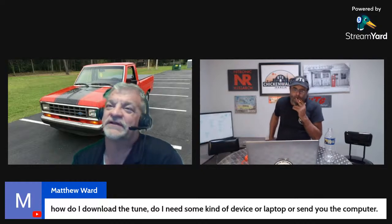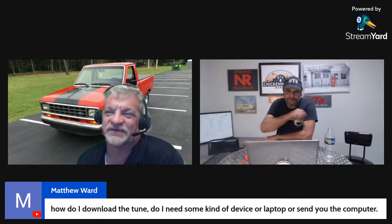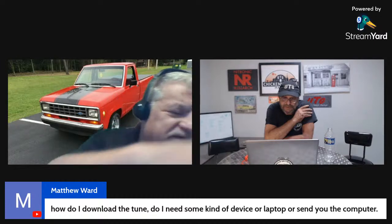Matthew Ward, how do I download the tune? Do I need some kind of device or laptop or send you the computer? Yes to all, but don't send me the computer. I don't have a bench harness for that Grand Marquis computer. But you need to have some kind of tool. I use HP Tuners, and there's a dongle device laying on my desk here somewhere, which plugs into the computer. The software for your computer is free, but you've got to pay for the device and to pay to access your computer.